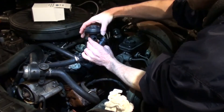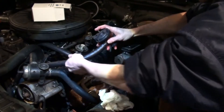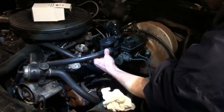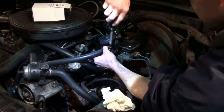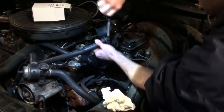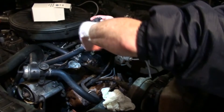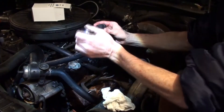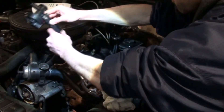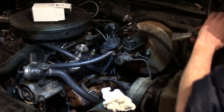I'm going to put this off to the side so no antifreeze will leak out from my heater core. Then I'm going to go ahead and put the new heater control valve on and tighten down the band. These don't have to be extremely tight — you don't want to break or crack the plastic on the new heater control valve. Just snug them up to where it isn't going to come off and you should be good. Try to keep this as high as you possibly can.